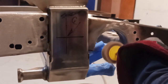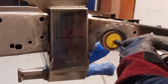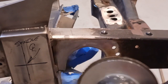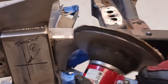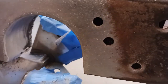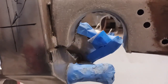Now we've got a flap wheel, probably about 60 grit, and we're just taking out any lines or grinding marks, making everything really nice. If we had flush-fit this and welded, we would have burned through the weld or at least made it weaker in that area. Now I've got an 8-inch orbital sander with 80 grit. We'll hit it with this and leave it for now. Before powder coating, once all the welding is done, we'll come back with 120 and then 220. Here's a shot of what we've done so far — the inside still has to be dressed down.